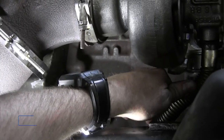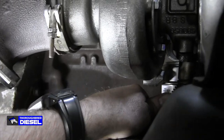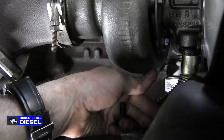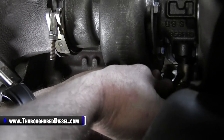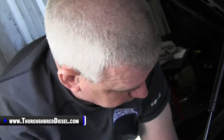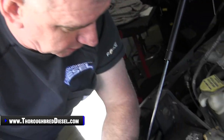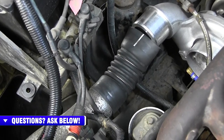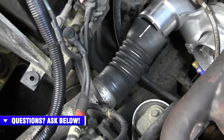You can see the gasket is on. This little stick 'em stuff I was talking to you about does a good job of that. So I'm trying to hold a light and hold the tube at the same time. So we're gonna go ahead and place our two metric 8 bolts in. We've got our drain tube hooked up, so we're really at our finishing touches of oil fill line or oil supply line and the intercooler pipe.